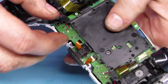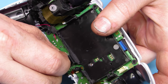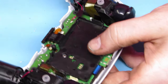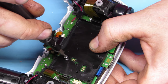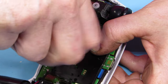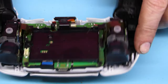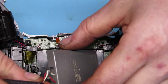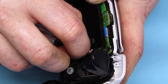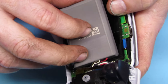Battery plate back in. Put our little microphone ribbon cable back in. Now we've got all our connections, so we put our one screw for the battery tray back in. Then we've got the battery itself, which we will now connect. Make the connection, then lay the battery back down — it will only go in one way. Do not force it to try and go in the other way; you will short things out.